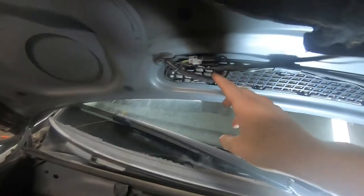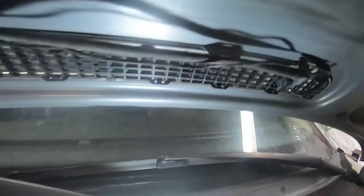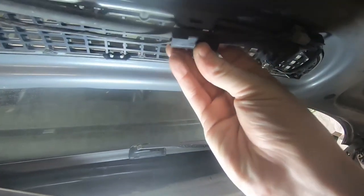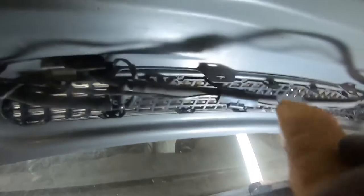The hardest part is getting the hose and electrical out for the windshield washer sprayers. I've already pulled one of the clips off over here — I actually broke this one. It's this little clip that goes over the hose and electrical, and it's got a piece that wraps around underneath this piece of metal and clips it in there. All you need is a flat screwdriver or an exacto knife — slide it in underneath the metal on top of the plastic and just pry out a bit and it'll slide the entire clip off just like that.